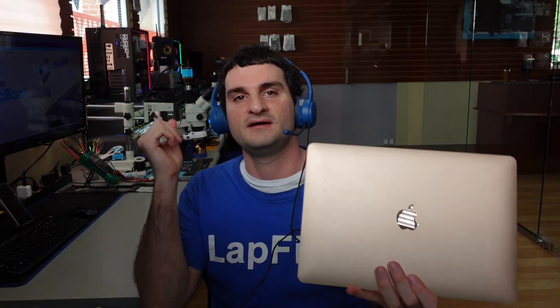I have a working one here because we're going to need that in just a little bit, but we have this MacBook — it's actually completely dead. Sometimes some of the symptoms are when you plug it in, you're getting enough voltage there, but sometimes the amps really won't go up or they'll maybe go up very, very slightly. If you check on the voltmeter, then it'll just climb all the way back down. Another good symptom is when you try to touch the trackpad, you'll feel that there's a little bit of forced touch there, so it seems like it's on, but there's no keyboard, no caps light.